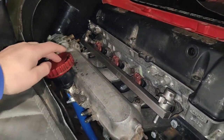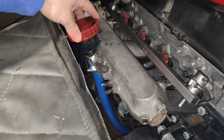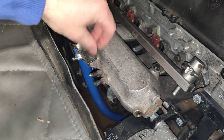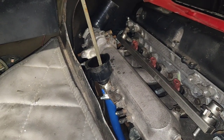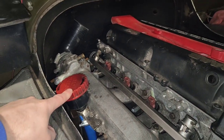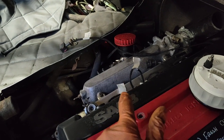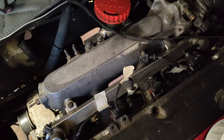I've just fitted the dipstick. Originally the 9000 dipstick would hang off a bracket which I didn't have enough room for, so I made this little alternative bracket to push it off to the side and then just used rubber flexi pipe - it's only a plastic PVC pipe anyway - and that goes down to the sump. On the Saabs the dipstick tube is the filler and where the dipstick goes. This is off an old eight-valve 900 I think, so what I've done is because the min and max marks won't tally up to this sump - on a 900 it's very narrow but deep, on this engine it's not - so I've chucked four litres of oil in, made a mark on the dipstick, chucked another litre, made another mark, and I'm going to use that as minimum and max. You might be wondering why I haven't just gone for the 9.3 dipstick filler which comes in between the inlet manifold and the head - that's because it will not fit with a 9000 inlet manifold. There just isn't enough room to get it through.